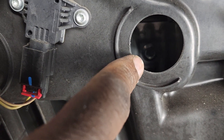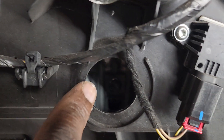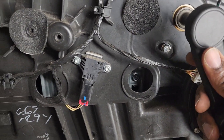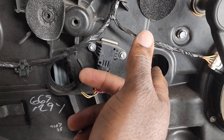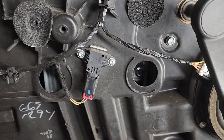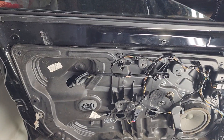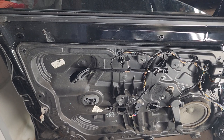There are two screws, one here and one here. Use the handle until you see those two holes, then loosen the screws inside the holes, and then pull out the window. Thanks for watching — if you have any questions please leave them in the comments, subscribe, I appreciate it.